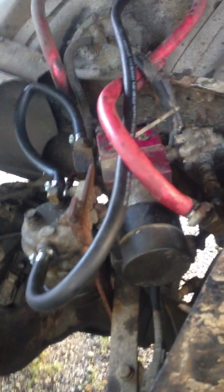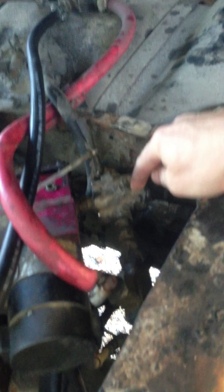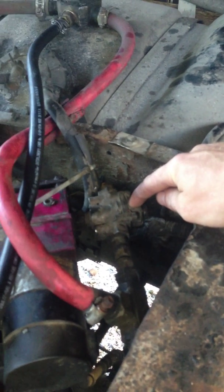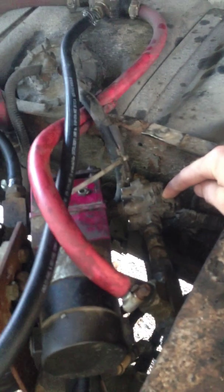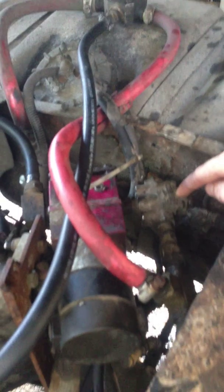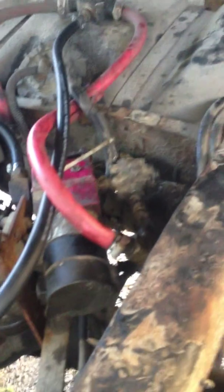I'll start at the rear of the tank. Right here we have your heated fuel pickup. It goes into a water sedimenter — I was told it's better to have it on the vacuum side of the pump. Here I have an older FAS model pump and then a pressure regulator to get it to go no more than 6 PSI, because I have an old indirect injected 7.3 liter diesel Ford engine. I'm also utilizing the hose-in-hose fuel lines as a supply and return, so I have coolant running all the way back to the tank.